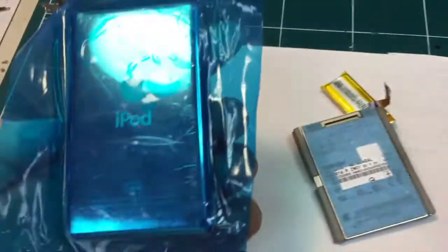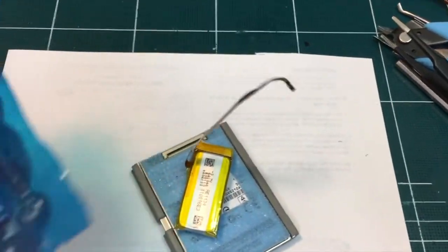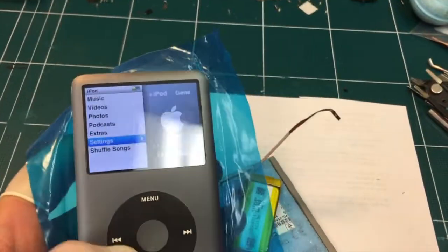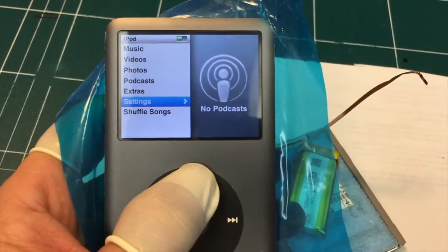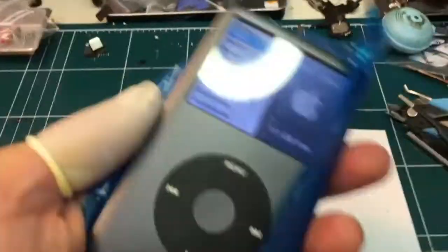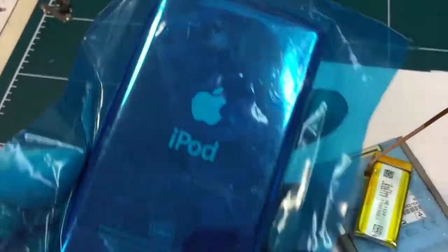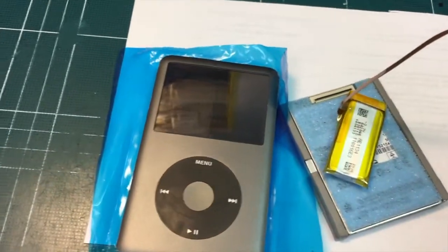The back cover has been replaced and we got the new battery in there. We tested the battery and it was fine. Here we are — the iPod 6th generation with the new SSD hard drive, restored with iTunes, no problem, everything's working. Now you can shake it; there are no moving parts in it anymore, so it can handle a certain amount of impact. It's worth giving it a shot if you want to keep your iPod.